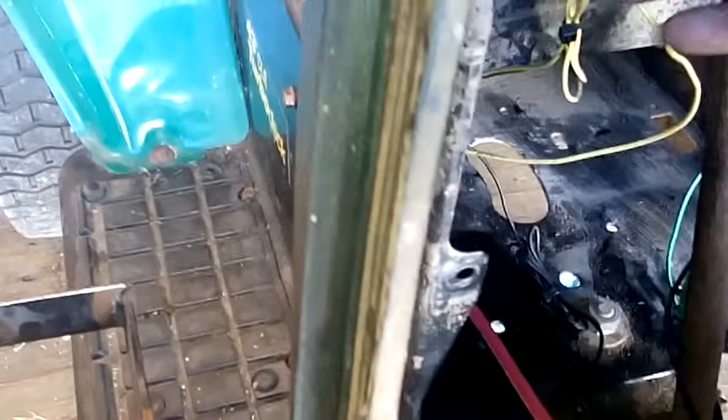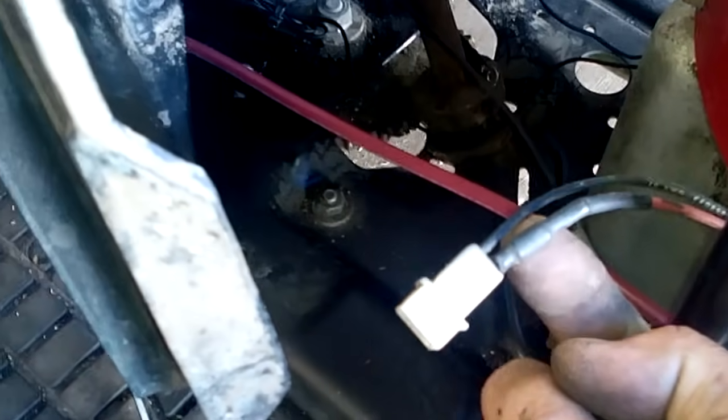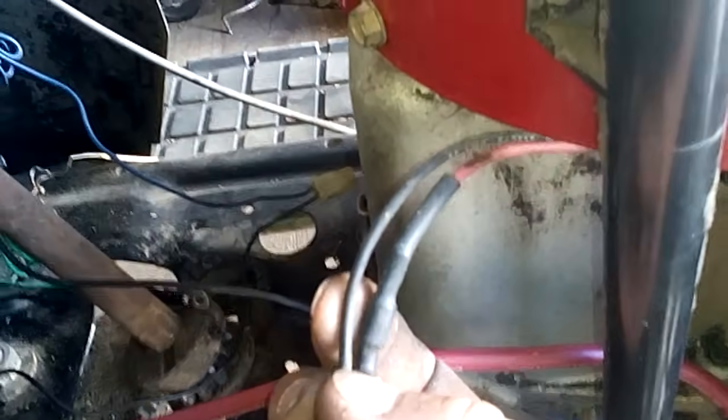You will find a red wire — the one with a diode in it. That diode is to prevent back charge to your alternator. It comes out from underneath your flywheel. There's one with a diode and one without — the one without is what powers your lights. When you want to get creative on wiring this up, just snip an old connector out. The side with the diode is going to run right back here.